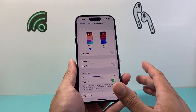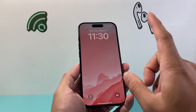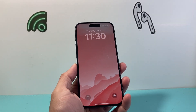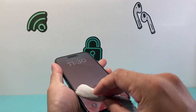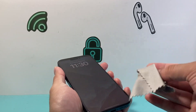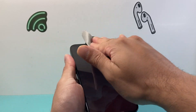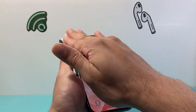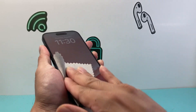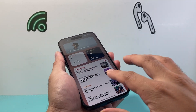If you're still having issues, you're going to want to try cleaning your iPhone screen. If there's dust, lint, oil, or grease on the screen, take a microfiber cloth and simply wipe it down, because that can interfere with the sensors built in for the auto brightness feature on the iPhone. So make sure to clean especially the top area of your iPhone.